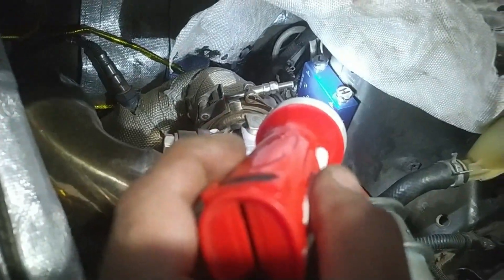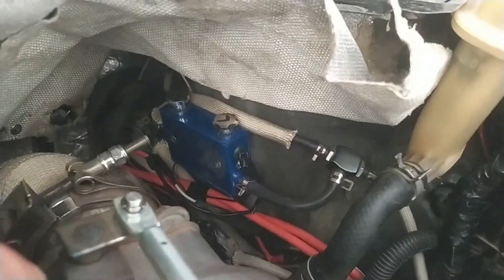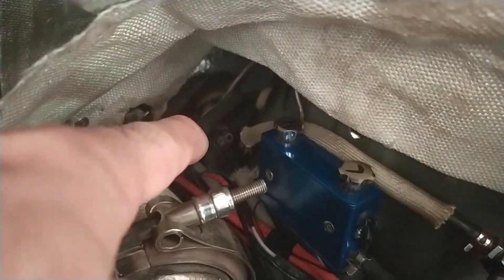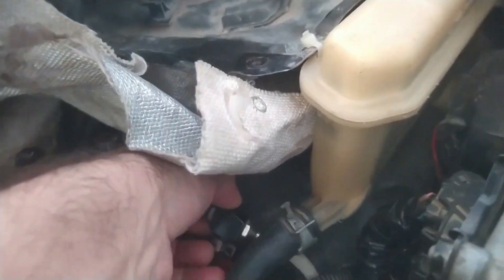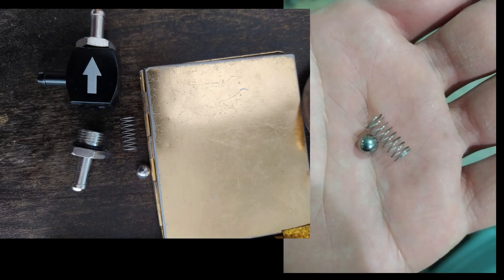Now I will connect a switch, a power source, and then apply the vacuum source. The controller is fitted. Here is the vacuum setup: this is the boost from the turbo going into a T-fitting. The inside car line goes to my boost gauge and the other one comes into this. This comes with this boost controller — it contains a spring and a ball inside for quick spool. Due to the quick spool, the boost will spike slightly — for example if this is set to 7 psi, the boost will spike to 9 psi and then stabilize at 7 psi.